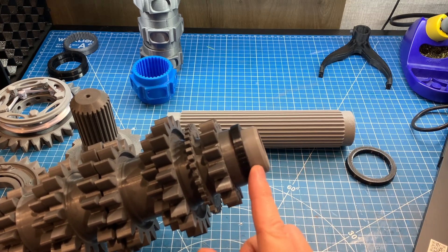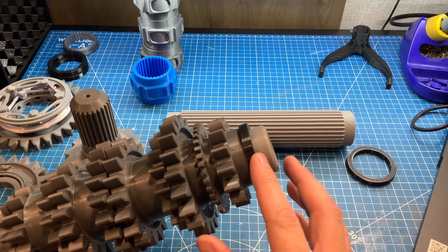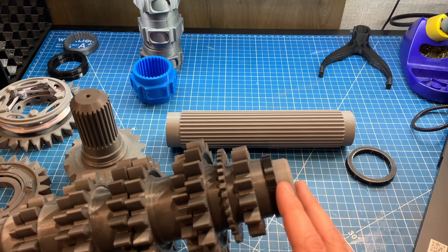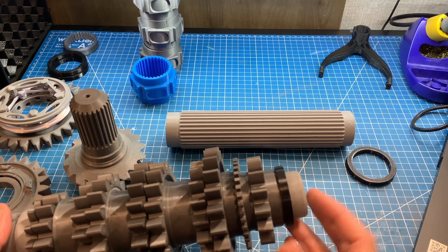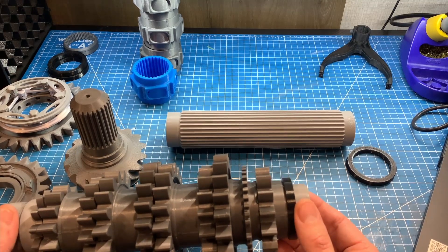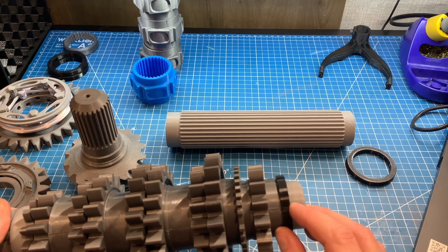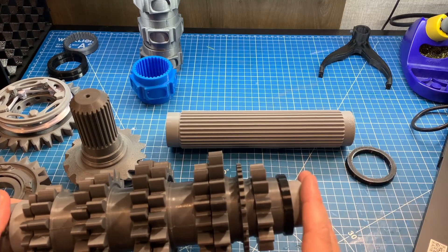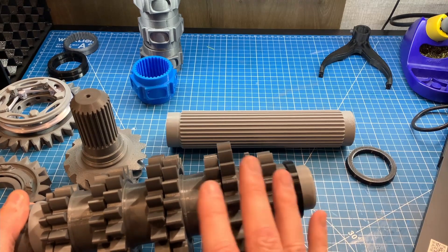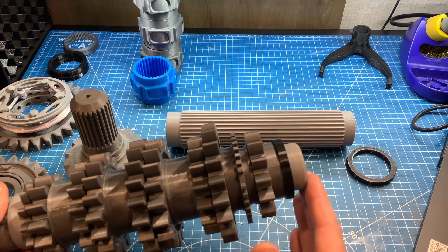The information I received about the real gearbox didn't include any of the lay shaft spacer information, but based on other gearboxes that I've seen they typically do put these tone rings somewhere on one of the spacers, usually at one end. Second gear fits here on the end with its smaller spline, and then there's just a short spacer between this and the actual bearing itself. This black piece is just a placeholder for the bearing that I 3D printed from nylon. I'll be getting the real bearings in here later. The real gearbox would have some crazy angular contact bearings here, so I made some changes to fit these smaller ball bearings. Oddly, I haven't seen any retainers or circlips being used anywhere on these gearbox shafts. I've seen a couple items that look like they might have been pinned to the shaft, but I'm not entirely sure. The retainers aren't entirely necessary if you have really precise tolerances for all the parts, and ease of assembly is most likely less important than lowering part count for Formula One teams.